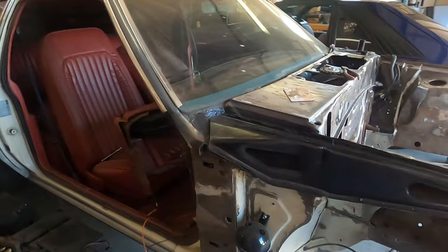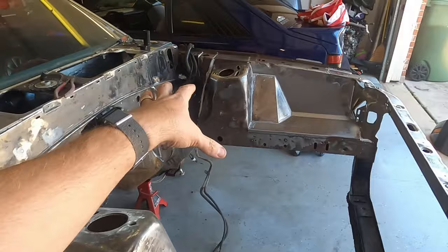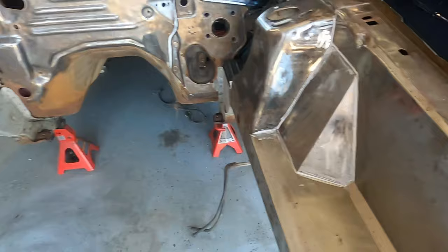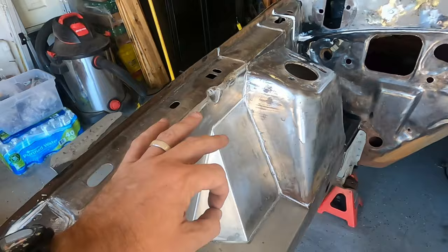In the last video you saw me working on the Scott Rod panels, and we've got the KBS rust seal here. The black parts have been KBS rust coated, so you'll see some of the black here. I've got 3M seam sealer that's meant to go on bare metal, so I've seam sealed the seams on the Scott Rod panels. The Scott Rod panels are fully welded in. They've got all the seams nice and smooth, so no rivets, no bolts, no overlap, no gap, no weirdness. It should look like it's part of the car as it should.